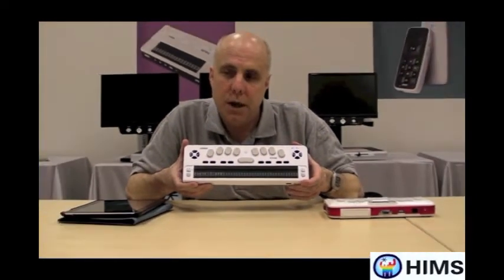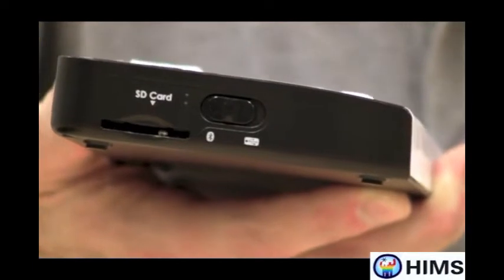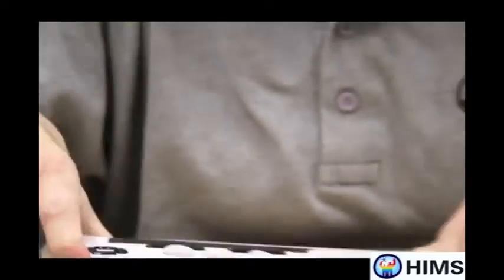But the reason we're together today is to show how it works with the iPad. Before we get started, there are just a couple of things to check before you connect it with your iPad. First, on the left side there is a little switch — the switch needs to be in Bluetooth mode. If the unit is facing you, press the switch forward to the front of the unit. That allows the unit to send a signal to the iPad. The second thing is to make sure it's in terminal mode. Terminal mode allows every item on the iPad to show up on the Braille Edge. So I'm going to press the space bar in the main menu until I see the word terminal mode in Braille, then press enter to activate it. Now we are ready to go.